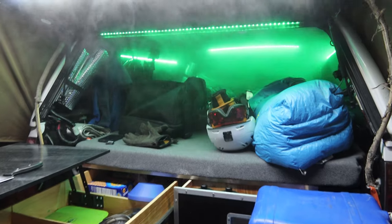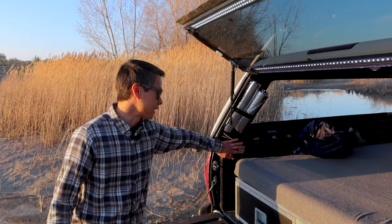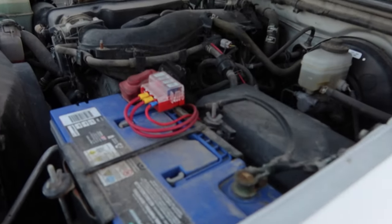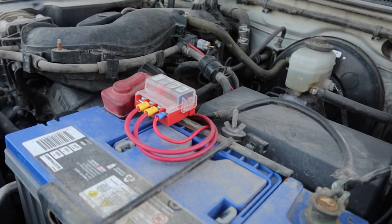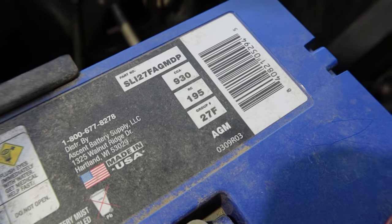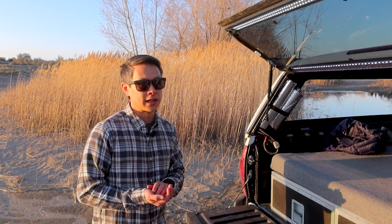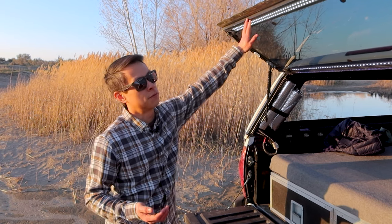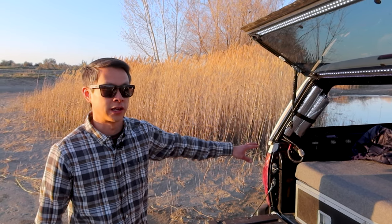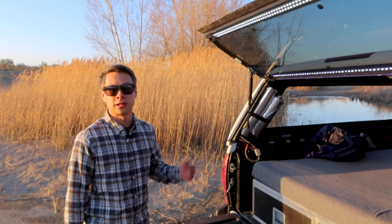When I need to get serious, I turn on my serious lights that put out over 2,000 lumens, which gives ample task lighting for cooking after a long day's adventure. All lights are dimmable. As for wiring, I have them run to a connector next to the brake light connector, all home-run to the main battery through a fuse block. The battery is a combination deep cycle starting battery that holds about 900 watt hours of energy. I calculate I can run the lights for about eight hours without worrying about the truck not starting. The lights are about $60 and super worth it — I'll link them in the description.